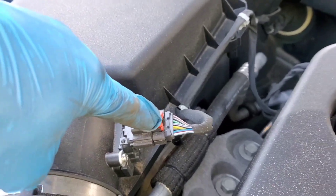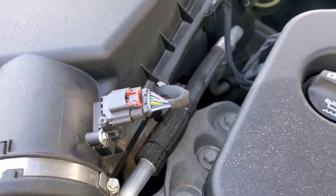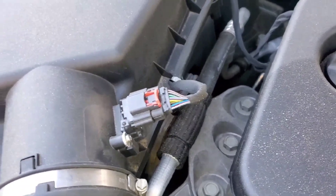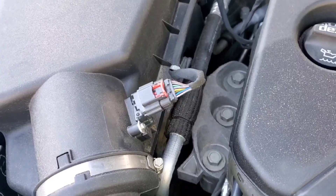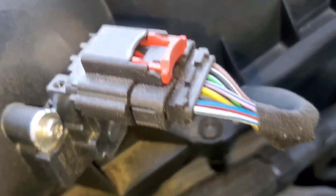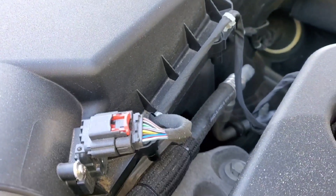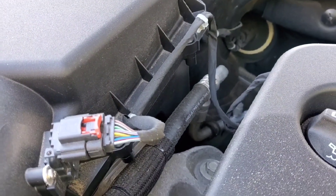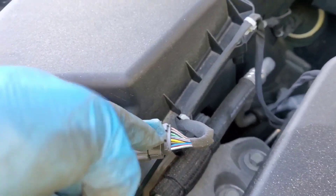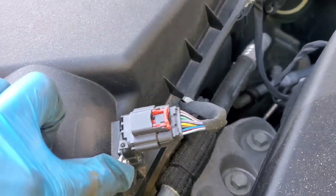If you're starting to have engine issues, you probably have a high-mileage vehicle and may need to replace the mass airflow sensor anyway — so you might as well just swap it out. It's inexpensive, easy to get to, and easy to replace. If cleaning it doesn't fix the problem, just replace it. This particular sensor is one of the easier ones to access on any vehicle. If you have any questions, leave them in the comments. Please subscribe and give me a thumbs up — appreciate your time, take care.